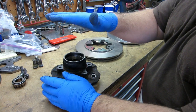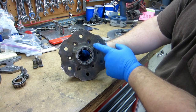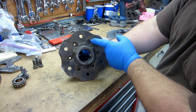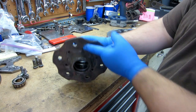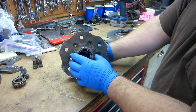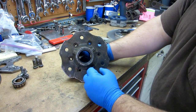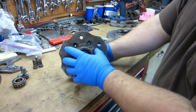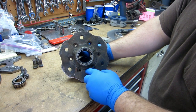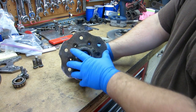What I've done in the past: this is a 720 hub, a hard body hub. This centering nub here comes out to the middle of the holes, basically the mounting holes for the brake rotor. They can be used, but they don't fit the center of the stock rims or most 14-inch rims — that center nub is too big. A lot of guys just grind it down. I've ground them down with a 4-inch grinder before, and I've put them on the lathe and cleaned them up too. Either one will work.